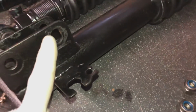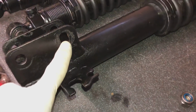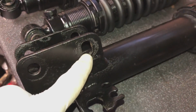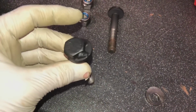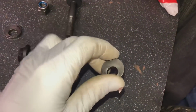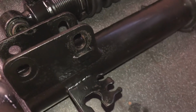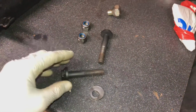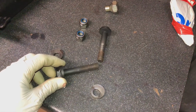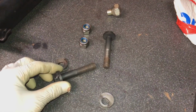So you can see on these coilovers, they've got an elongated top bolt hole. Obviously the bottom bolt hole just fixes with a standard bolt, and the top one allows for tons of camber adjustment. So you can see here, got plenty of adjustment, and we adjust that with these camber bolts. So you can see there's an eccentric washer on there that's welded on, and then also there's an eccentric washer that goes on the other end, and then actually on the shock itself is a bit of metal that you put the eccentric washer up against, and as you turn it, you can see you can move the camber in and out. So we're going to run these camber bolts on the top so we can run a nice bit of camber. Obviously we're going to have to run spacers for the big brakes, so we'll be able to tilt that tire in, because I don't want any scrubbing on the arches.